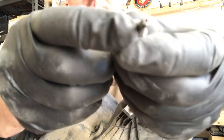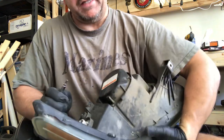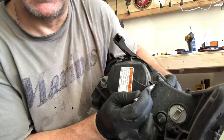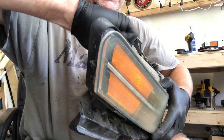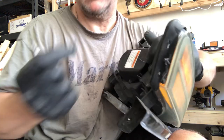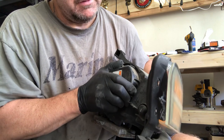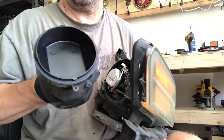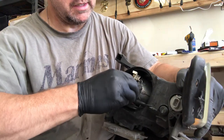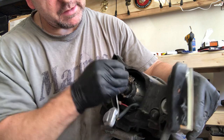The T20 — you can see it's got a little divot in it because the screw has a little nipple inside of it. I know you can't see it with this little iPhone video, but that just goes in there and you unscrew it. Take the screw out, then righty-tighty lefty-loosey — pull this out. That protects your igniter cable and the light bulb. Basically you just take this igniter cable, slide it off, and disconnect the ground.